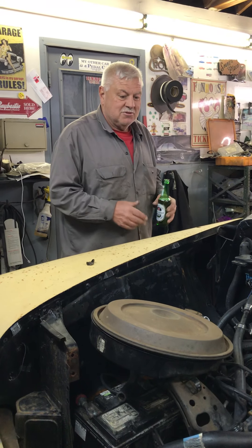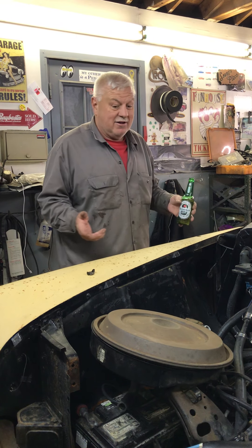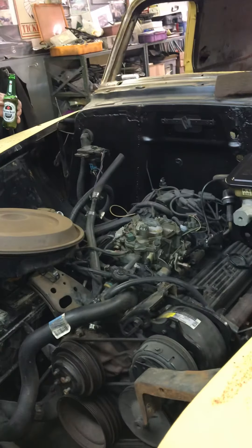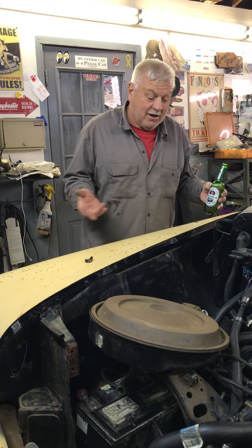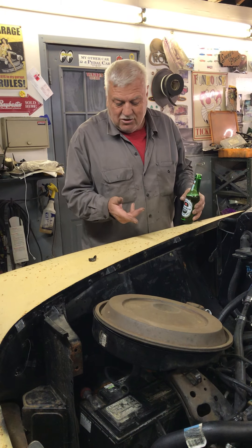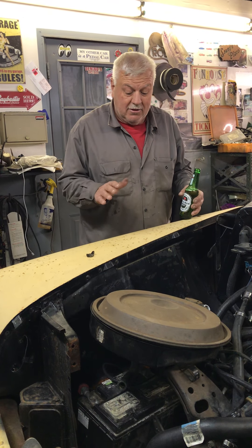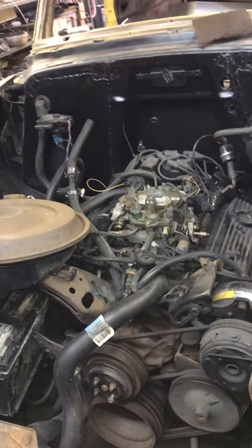So I took the frame and stretched it 13 inches. Next problem — the motor was too far up. I took the motor mounts and slid them back, moving the motor back about almost 6 inches. The only thing I had to do was cut away a little piece of the frame so I could keep the mechanical fuel pump — this way the fuel pump can slide in. I had the driveshaft right in. So now you already have your V8.